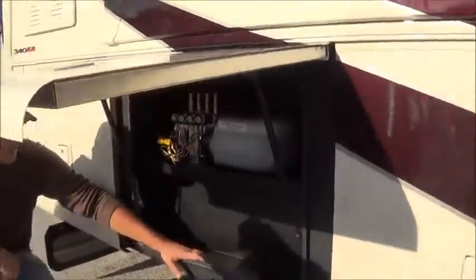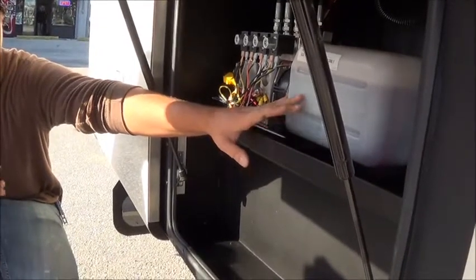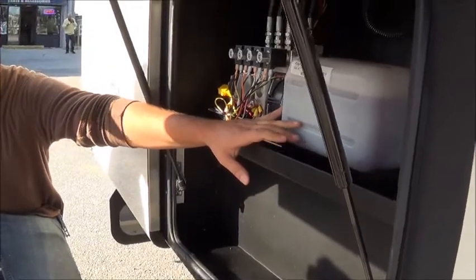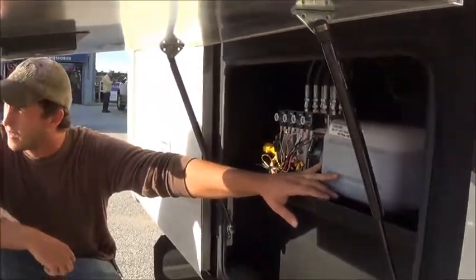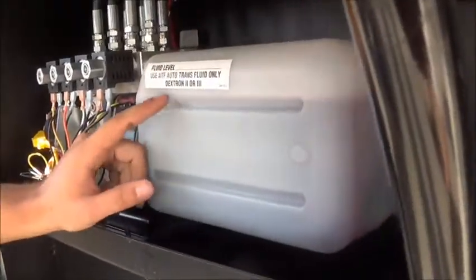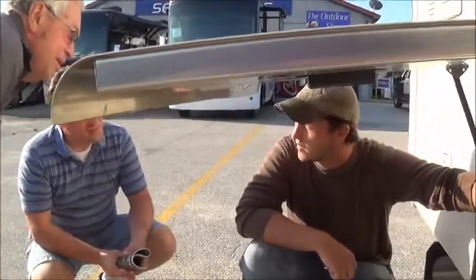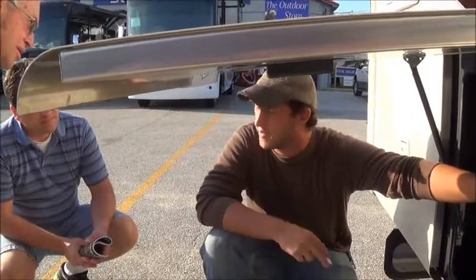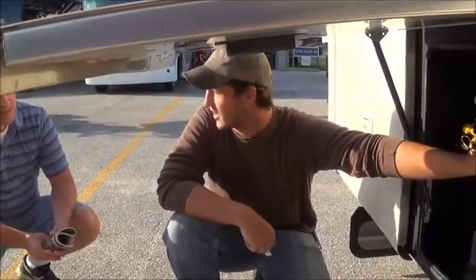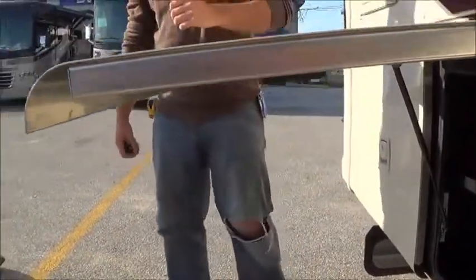In here, not really much of a storage compartment. You could put a few little things in the bottom. The top is not storage — this is going to be your hydraulics for your leveling system. It's good to go right now. You don't need to add hydraulic fluid unless this thing ever springs a leak. This should stay as it is. The actual tank indentation is where the fluid level is supposed to be. If you ever see this get low, first check for leaks — make sure you don't have any puddles underneath. If it is getting to that point, I'd recommend bringing it in for service rather than just adding fluid as a band-aid.